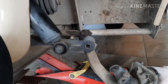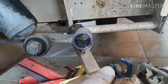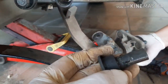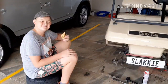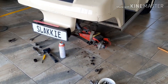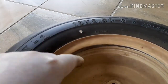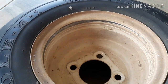We've just dismantled the top half. Just to show you — we take this bushing out, check on the inside: the whole thing is crumbled. Look at that. I've got to keep this bushing as a sample that we'll take through when we buy the next one. This is how it looks when it's all dismantled — quite a mess, a lot of dirt. Those bushings were in a terrible state. This is the wheel that had the problem — you can see on the inside of the wheel, that's where the lower part of the leaf spring actually caught the wheel because that bushing was not doing its job. That's what we're replacing.